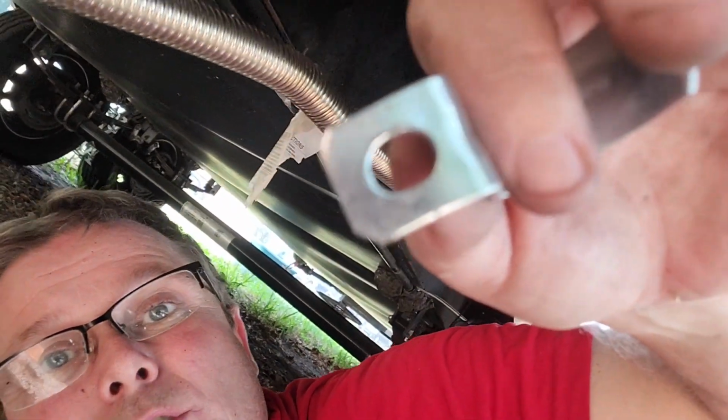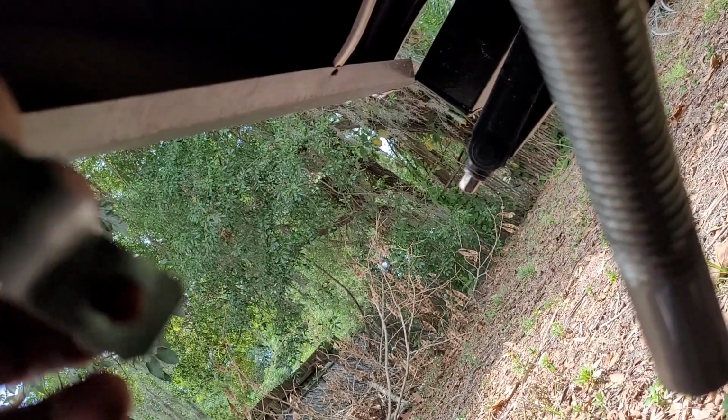That did not work. So we're gonna have to go the way that I did the other two because that hole right there is too big. It doesn't work because of these clamps that I have. It deforms it like that and makes it flat on that side, like a typical rivet. This guy is not wide enough, so the bracket here, the little knob goes right through it. So I need to have the flat part of the rivet on this side.